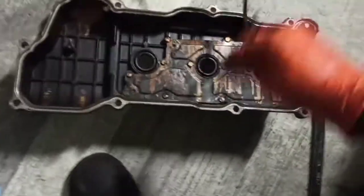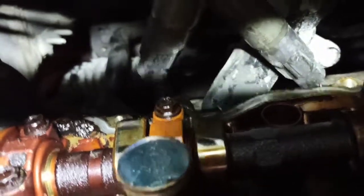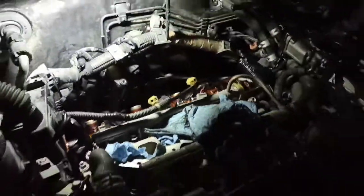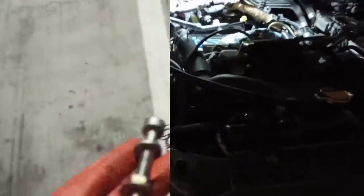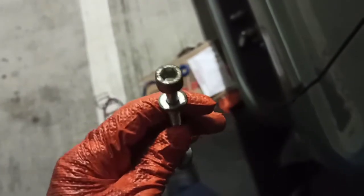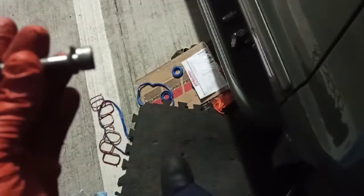The gasket is pliable but I'm not sure why it failed. Let's look at the cam lobes. There's a little bit of buildup to the right — that oil change wasn't done properly; you can tell. But otherwise, not bad. Time is money so I've got to move. This was the hardest part of the job anyway. Here's a good tip for keeping track of bolts: I thread each bolt through a piece of cardboard labeled for each area — like the 8mm allen and 14mm for the plenum.